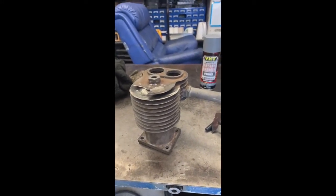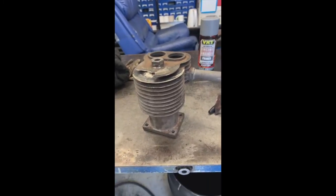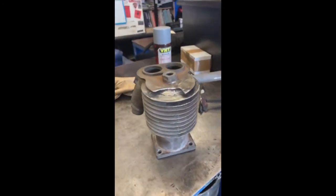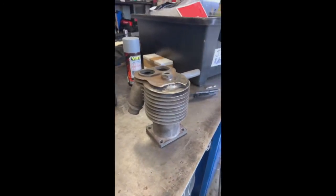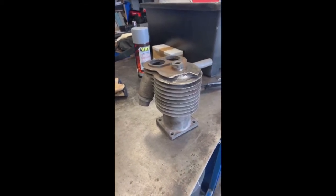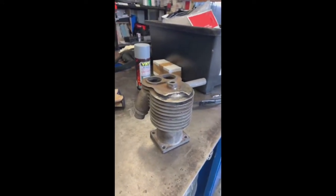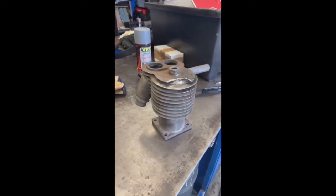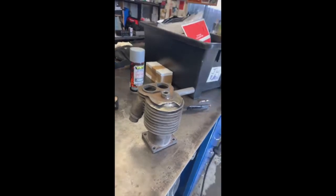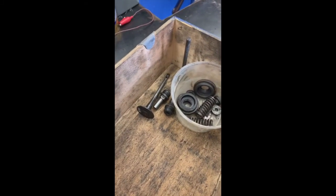Obviously the material I'm welding in will be of higher quality than the 19th century, pre-World War One cast iron, which has a lot of pockets of carbon in it — which isn't great, but it is doable. They will sometimes crack; you'll get a hairline crack, but that's not the end of the world. If they fall out we can do it again.